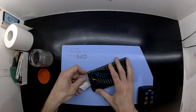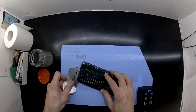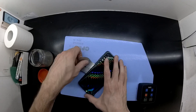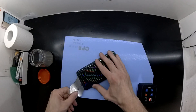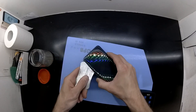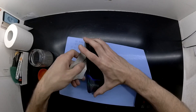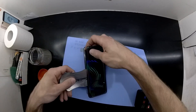Now that I'm back to regular speed, I found that getting the back cover off the A series is a lot easier compared to the S series. I believe that's because the back on these ones is plastic where the S series is glass, so you do have a lot more flex and can actually bend the back considerably more to get into it. Which overall I find fine on most phones, as typically they live in a cover, so the plastic back is perfectly acceptable. Glass I just see as another fancy way to make the phone feel more premium, but at the same time increase the risk of dropping it because you can't actually grip the phone properly in cooler weather.